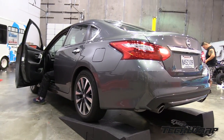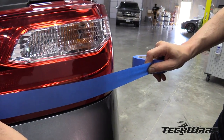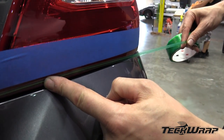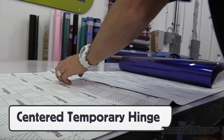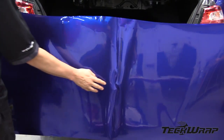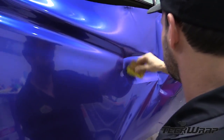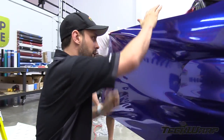For bumpers, take the time to place the vehicle on race ramps to help the install. If the hardware can't come out, lower the surface energy with masking tape, then use cutting tape to tuck the film under. Create a temporary hinge right in the middle of the panel and line it up on the hinge of the trunk. Work the film about 30 centimeters away from the center, then get an extra set of hands to help on the corners. Because this is a multi-layered film, it's best to use an IR heater to soften all the layers.